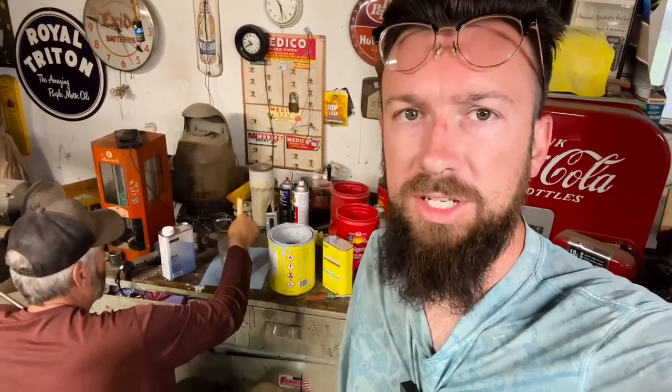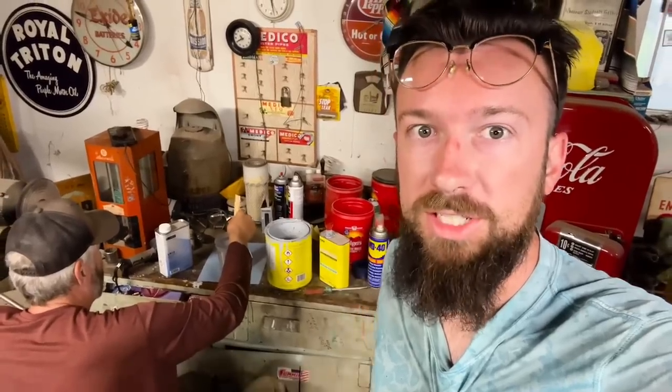I heard a story. There was one guy who got trigger happy with sanding his car. Before you paint, when you sand your primer, you're supposed to sand it with 400 grit and then you paint it. But he got real into it and he sanded it with 400 and then he sanded it with 800 and then he sanded it with 1200. I think he went up to 2000 grit sandpaper on this primer. I mean, the primer could have been the paint job by the time he got done with it. It looked so shiny, that fine grit sandpaper.